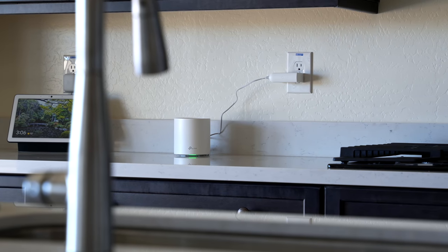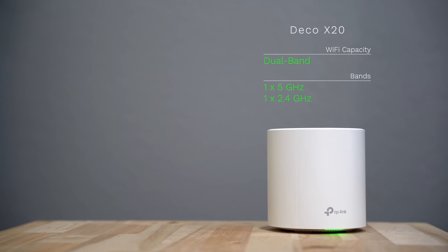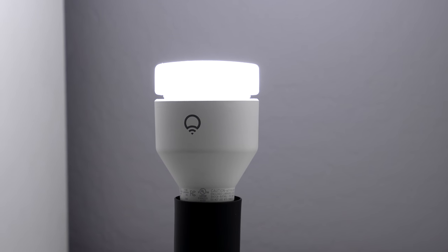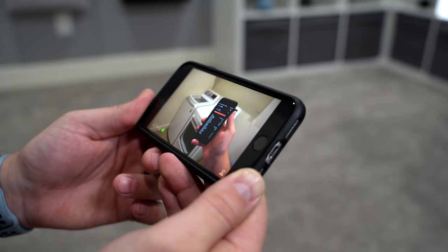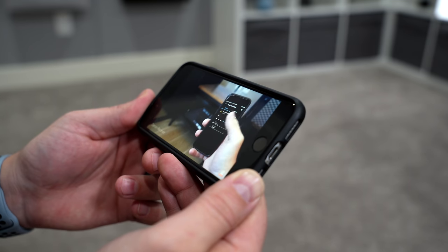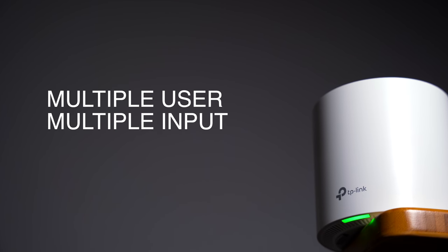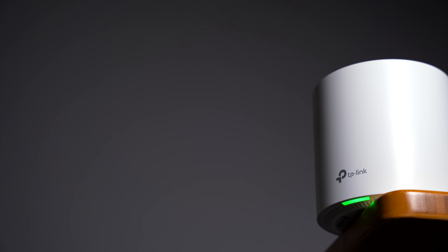You can connect up to 10 Deco devices and they're all interchangeable, so you could add more powerful Wi-Fi 6 Decos later. Since the X20s are a budget option, they're only dual-band like many others in this price range — one band for 2.4GHz and another for 5GHz. More expensive options will have tri-band with two 5GHz bands for more bandwidth. Many of your smart home devices will use 2.4GHz, but some, like the Echo Dot 4th Gen, can use 5GHz for faster speeds. If you have a lot of devices including phones and computers using 5GHz at the same time, then having multiple bands is something to consider. The Deco X20s also have MU-MIMO — multiple user, multiple input, multiple output — so devices compatible with that can have a dedicated stream with no interruptions. You can have four streams with the X20, and that can free up bandwidth for other connected devices.